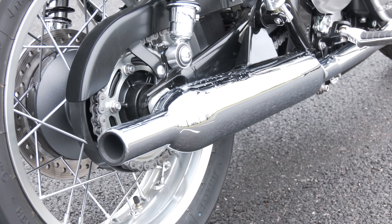One thing we don't often see on bikes now is a centre stand. People ask why you need one when there's a side stand, but it's really handy for maintenance like lubricating the rear wheel. Also, if you're going through the Channel Tunnel or on a ferry, it's nice to put the bike on the centre stand rather than relying on a side stand on moving terrain. It would be nice to see it as a standard item rather than an extra.